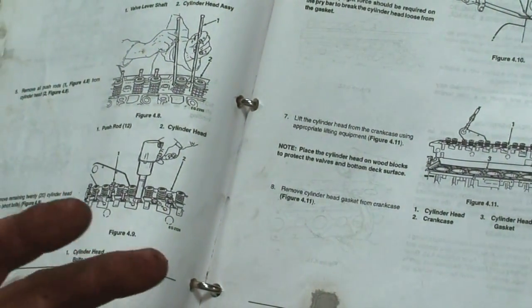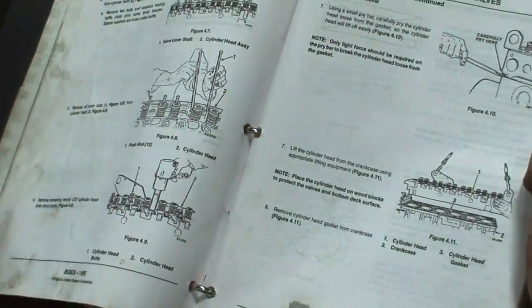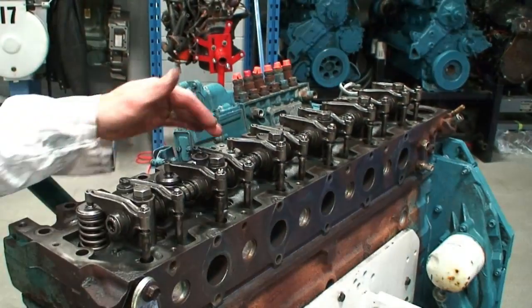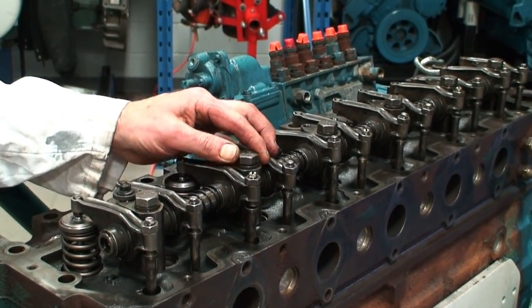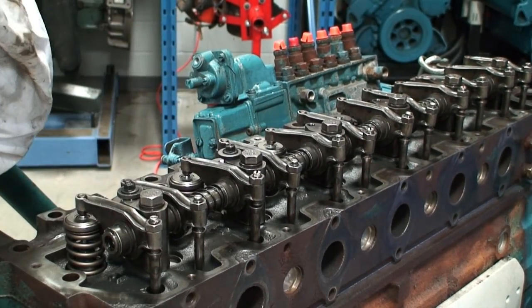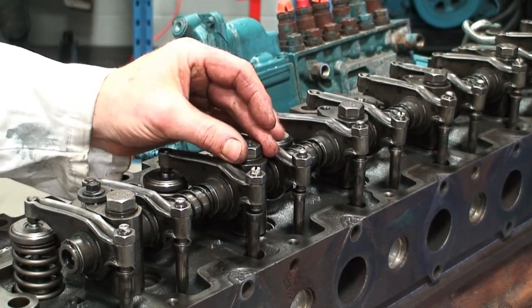You must be very careful if you're going to detorque a head with an impact gun. If you are going to pick that method of removal, I would recommend one of the first things that you do is go in here and crack these bolts loose with a Johnson bar. So then you break the torque and then you can run them out. If you run them out with an impact gun, you could run the risk of not having the hand feel of detorquing.